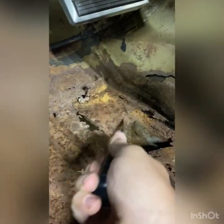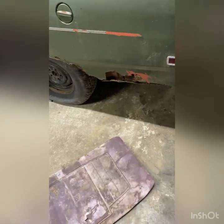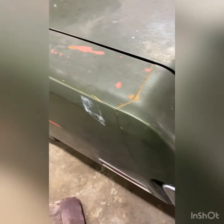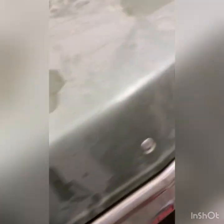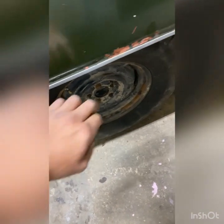You can see the spot welds — there's one there, there's another one up here. We're probably just going to grind it down and tear the whole front half of the floor pan off and replace the front half. We cut this quarter off — we're going to look and see how much a quarter panel is. Easton's kind of on a tight budget right now. Not sure what we're going to do about the roof yet. We're going to pull the back glass out first. What's crazy is this quarter panel is like perfect — it's the original quarter panel — it's got some rust there and there, but the rocker is pretty good, just a little baby hole we'll have to take care of.